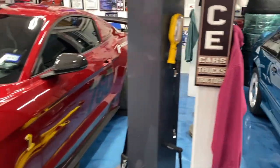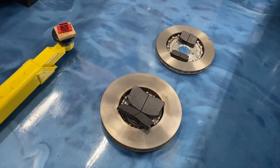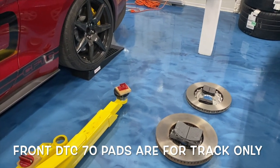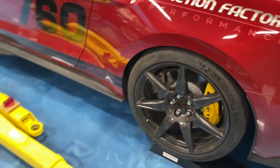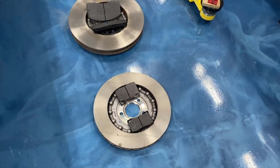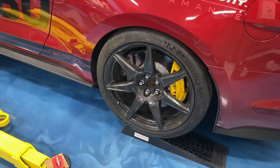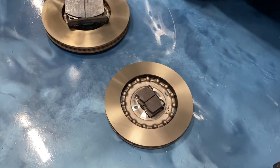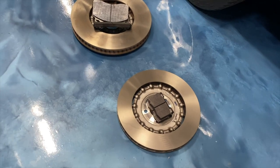I've got my car on the lift and I'm going to raise it up to get these pads swapped out. I actually have two complete sets of rotors for this car — these pads are not good for street use, as they need to be hot and run at track temperatures. So I'll have a dedicated set bedded with the DTC 70s and 60s for the track, and a separate set of street rotors with street pads. I had the track rotors turned to get a clean surface free of previous brake pad material.